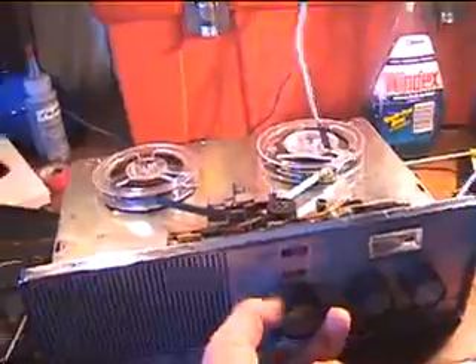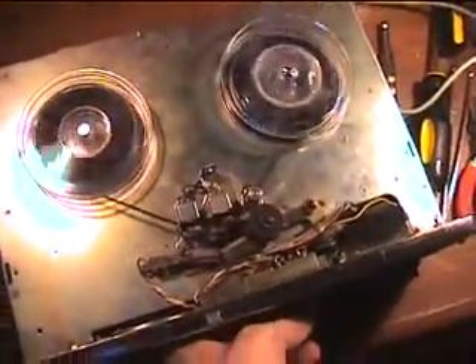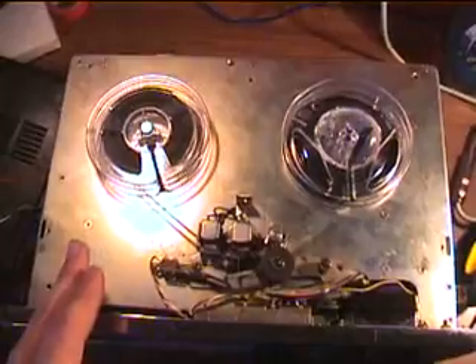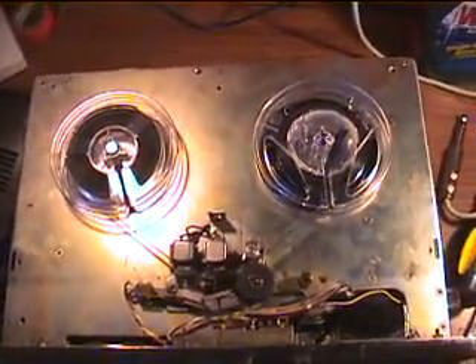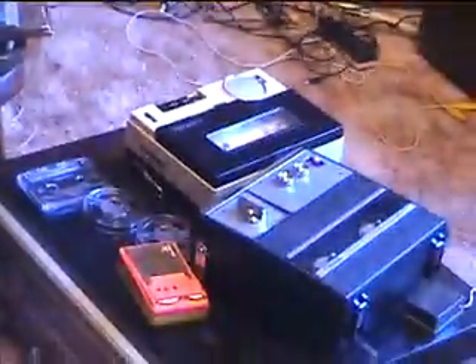Rewind is now working — before it was sluggish, but now it works. That's because I moved the motor to where it gets better traction on the belt. The second playback you heard was slightly slower and more distorted because earlier I had recorded some of it on the Elektra rim-drive reel-to-reel, the Elektra GP500 — I was just doing some experimentation with different machines. I have some machines like the Lloyds sitting out there because I was doing some experimenting.